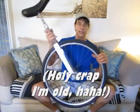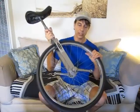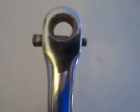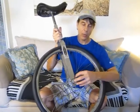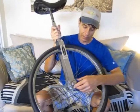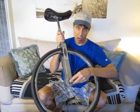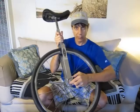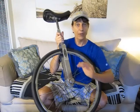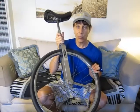Lastly, we'll talk a little bit about cranks and hubs. When I first started riding back in the mid-60s, I had this Schwinn, made out of Chicago — all steel, very heavy and also very weak. This particular unicycle utilized the cottered crank, which has long become obsolete. Over time, the cotter pin would get rounded off, and as you can see, no amount of tightening would keep it from moving. The axle is round and there's no axle bolt going in the center. What you would use after you put the crank on, you would insert the cotter pin, which is slightly tapered, and that would hold the crank onto the axle. The problem was, after a while, that cotter pin would round off and no matter how much you tighten that bolt, you'd have all this play. So that wasn't a very good system, but that's all we had way back when.